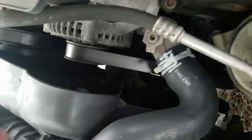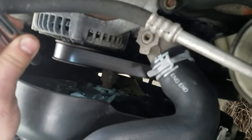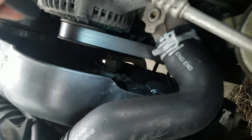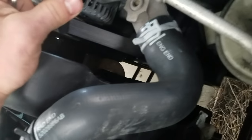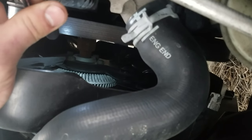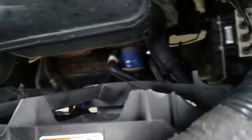On this one you can notice it has a mechanical cooling fan — the Ford has an electronic one. You can see it's got what we call a fan clutch. Right now I can rotate it pretty easily, but as this engine warms up, that fan clutch tightens up — there's a coil in there — and with temperature it tightens up and makes that fan spin faster and faster. Hopping back over to the Ford, we have no cooling fan here, but we do have electric fans, which are really hard to see. There's our radiator and there are our electric fans.